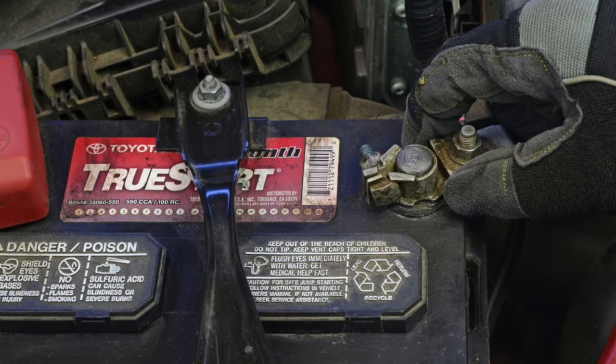But luckily, you have options. The first one is, if the car is going to be sitting completely idle for months at a time, you can completely disconnect the battery from the terminals. The nice thing about this is that it won't have any charge running through it, and so it will maintain its battery life. The downside is that any car alarms and any of your presets will be gone, and I am not going to find that classic rock station again.